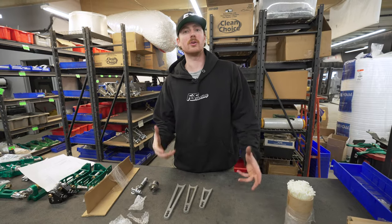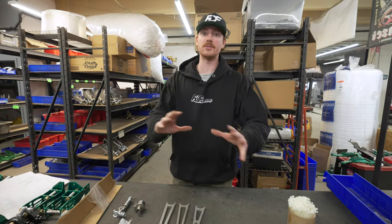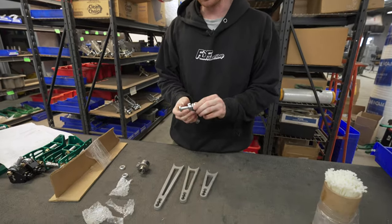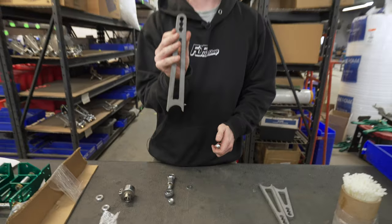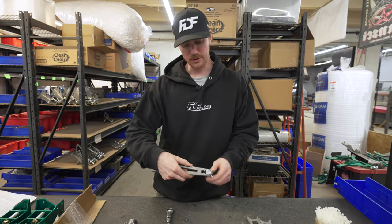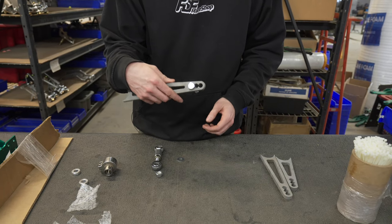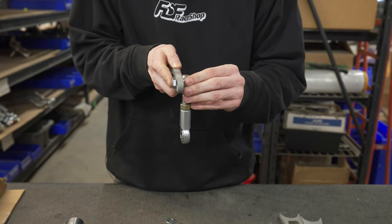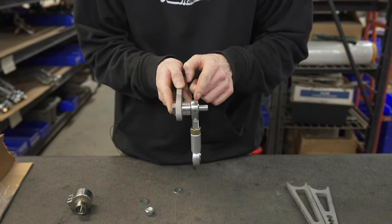How do we get more or less stiffness out of a sway bar? Let's assume you just have a stock sway bar. On ours we offer three holes in each blade — this is our 10-inch blade. If you run it on the furthest out hole, this is going to be your softest setting. The innermost hole is going to be your stiffest setting. Another way to adjust stiffness is if you mount the heim joint right to the blade, that's going to be your stiffest setting. If you add spacers and then put this on, this will actually be softer.